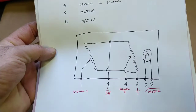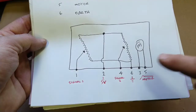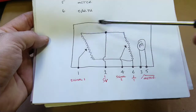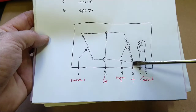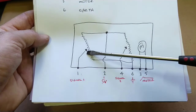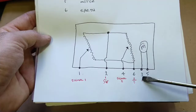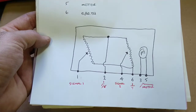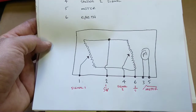I've drawn a little wiring diagram of what's inside the throttle body. It's a 6-wire sensor. You've got 5 volts coming in on one pin, and that shares 5 volts to both the tracks of the throttle body. On pin 6 those two tracks are both going to earth. Pin 1 has the first position sensor, pin 4 has the second position sensor, and the remaining two pins are for the supply to the motor to open and shut the butterfly valve.